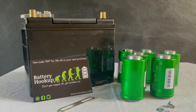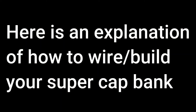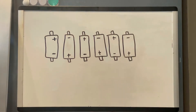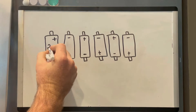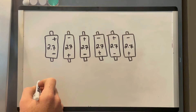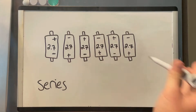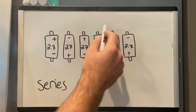Anyway, that's the plan with the battery delete super cap bank build. This is how we're going to be wiring these. We have six of them and each one carries 2.7 volts. We're going to be wiring these in series — that's what's going to get us to our final voltage — so it's going to be positive to negative to positive to negative, basically in a row.